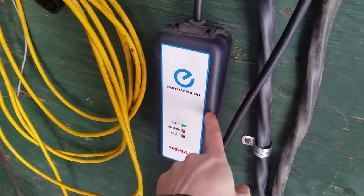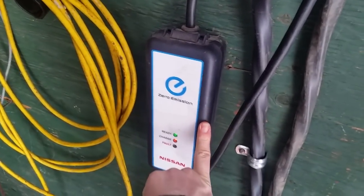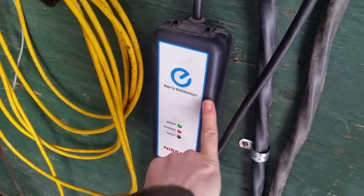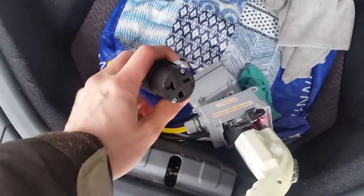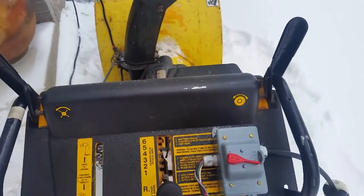All I've got to do is take this plug and plug it into there, then press this button on the charging station. Smart guys might think the charging station would recognize this — it comes with the Nissan Leaf and is only rated for 120-volt, but I hacked it to 240-volt. There's a 20-amp breaker in there, which is more than enough for the 12-amp motor. The power is on — this is exactly the same as any other industrial connector.